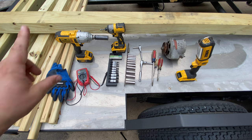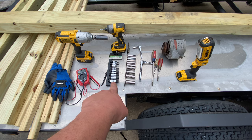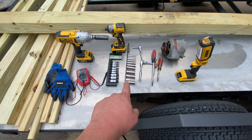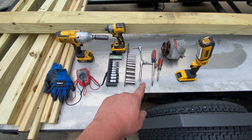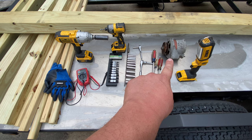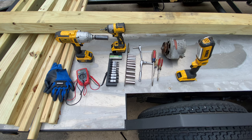Here's what we need to get started. You're going to need a way to take the wheels off. You will need some allen keys or allen sockets. You're going to need a voltmeter to make sure that it is charging when you're done. Metric sockets — I've got 3/8's here, and quarter inch ones if we need it. A couple of screwdrivers. A replacement alternator — this came out of my parts car and I know it's good, I've actually tested it. Some light, and you're going to jack up your car and get to it.